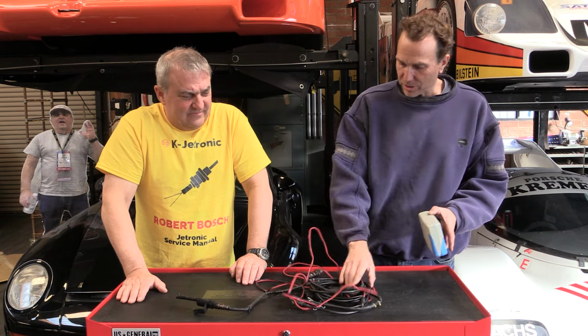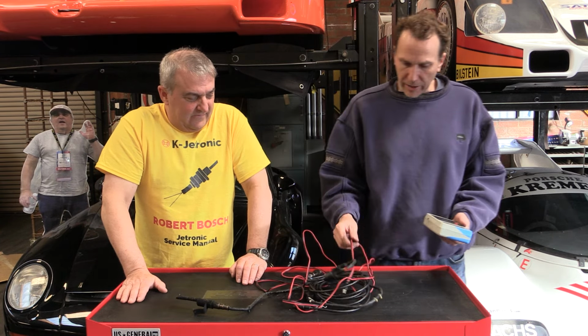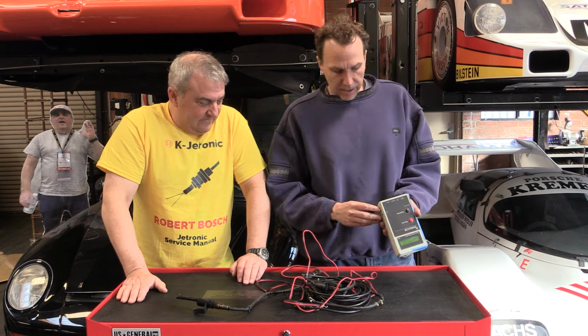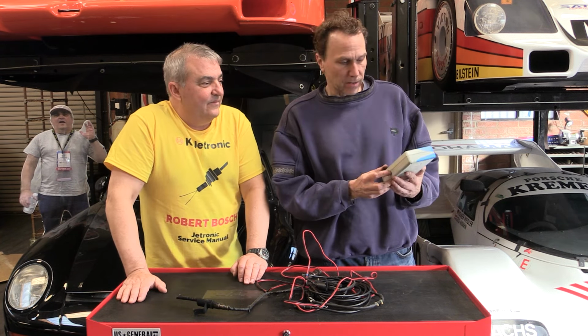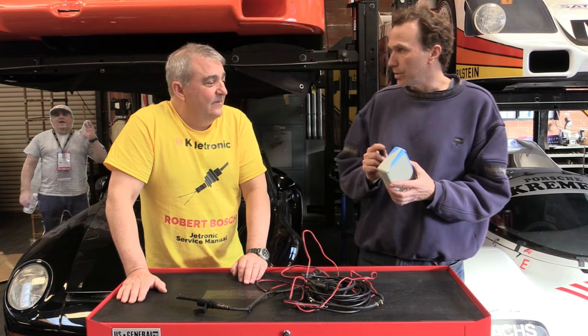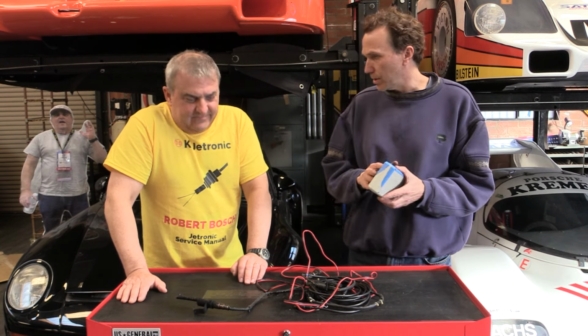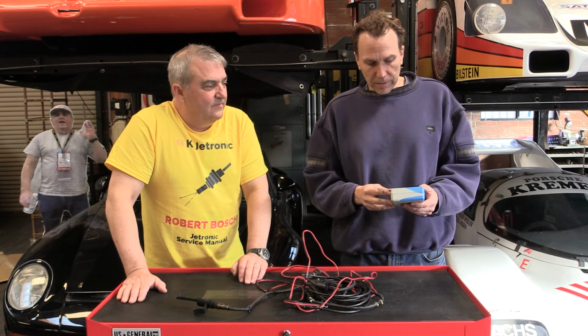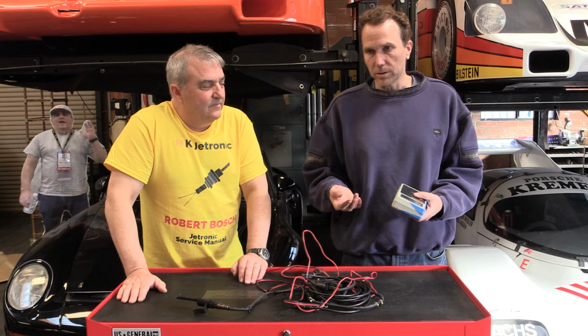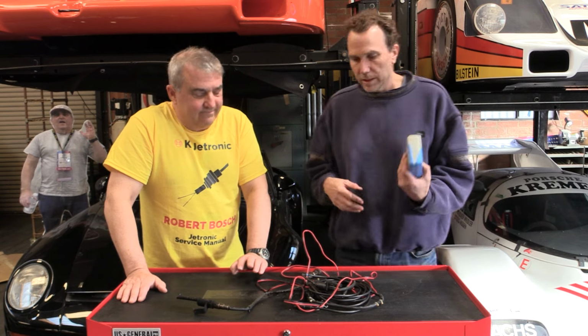And then this is all the electrical. You hook one to the battery, little hooks to the battery. This was the first version of this tool. Here's an on-off switch and all that stuff. And it measures the lambda, or the air-fuel mixture, right here. You want it to be about 14.7. We could talk for hours about that. But you also want to test under load, so you can't just use it at idle. You've got to be driving.